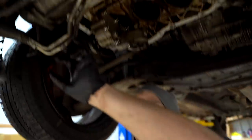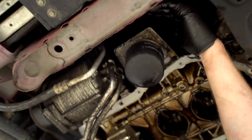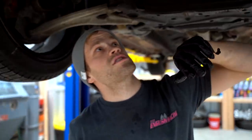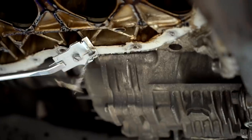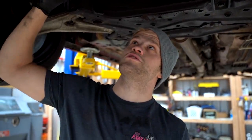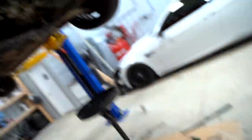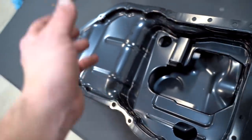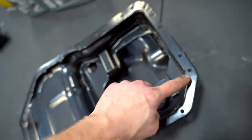I'm pretty sure the oil cooler lines have crush washers on each side up on top of the engine girdle that may need to be replaced as well, but for now we're just going to finish up this oil pan job. She's nice and clean under here — probably about 10 to 15 thousand miles on the build. Now the fun part: scraping all the gasket material. After doing the M and then coming to this thing, this makes me appreciate Evos — getting the M oil pan off was like three years, this is three minutes. We got the entire gasket surface cleaned up with a razor blade and brake cleaner. We're going to pull out the new pan, clean it up even though it's brand new, run through with brake cleaner, and then apply the sealant.